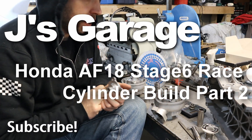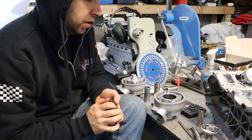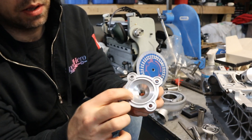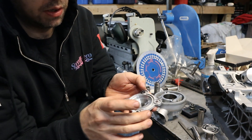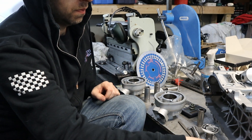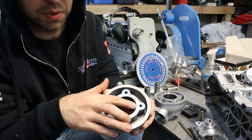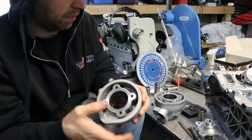Welcome back. Today we're carrying on with some more prep work for the Peugeot cylinder to Honda cases swap. When you machine the head back to allow the piston to go just over the deck height of the cylinder, you run into a small problem. On these Peugeot cylinders, there's normally nothing to align the head, and it doesn't really matter because the piston never goes much further up past the deck height — so you don't have to worry about that little bit of extra stick-out.